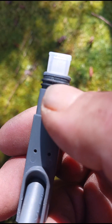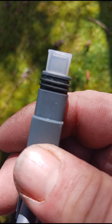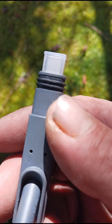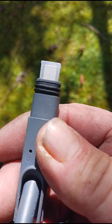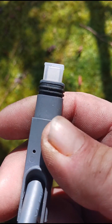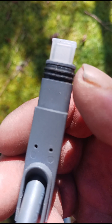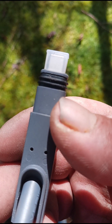The other thing of concern when you get up there is a little rubber boot seal right here. As I'll show you up top, it doesn't really seat and lock into the dish fully. Most Starlink stuff is engineered extremely well, but this has proven to be a little fail point — one of the biggest ones. You have to push that up in there and then seal it with a little sealing tape on the outside, because moisture can make it through these seals, get in, and short it out when the dish heater kicks on. That has been by far the biggest issue I've seen with Starlink so far.